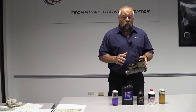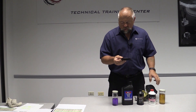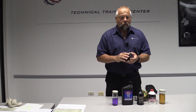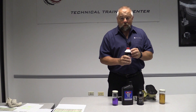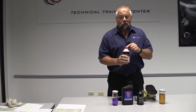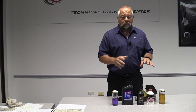So what kind of brake fluid should you use in your vehicle? Whatever the cap says on your master cylinder. It's typically written — in this case, the cap calls for use only DOT 3 brake fluid from a sealed container. If you had this brake fluid on your shelf in the garage and had the cap off a couple times, that brake fluid will start absorbing moisture immediately. The shelf life of brake fluid that's been opened is only a couple of weeks — that's how fast it absorbs moisture. You want to go from a sealed container that's never been opened.